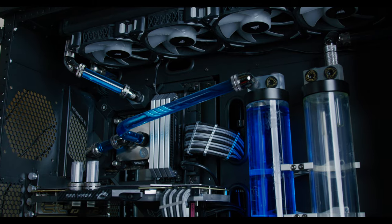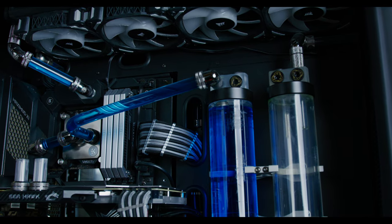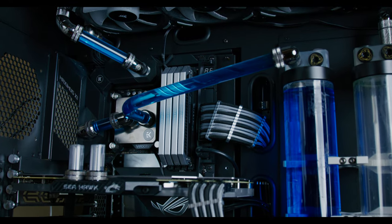So in anticipation of these being released, I have to do some maintenance work on my Case Labs case. Right now I have a 9900K with a Formula motherboard in there. I do have a 10900K in a separate system, but the difference wasn't enough for me to move it into this specific one, so I may leave that one in there for now. This is a dual loop system — I have a separate loop for the CPU and one for the GPU. Thankfully, that makes maintenance considerably easier. I don't even have to touch the CPU; I can just drain the GPU loop.